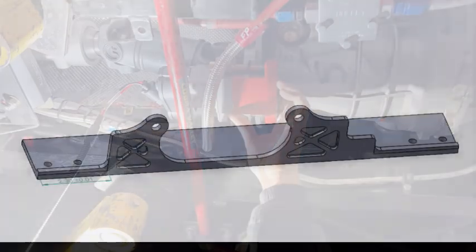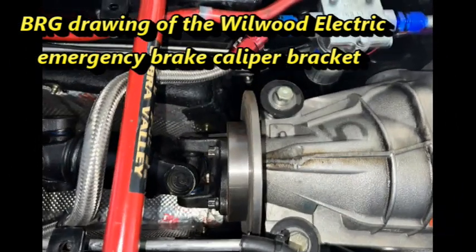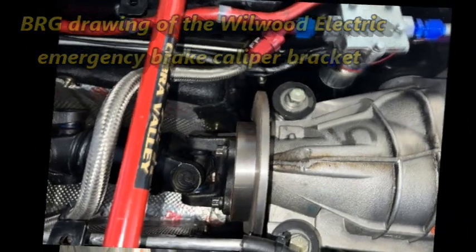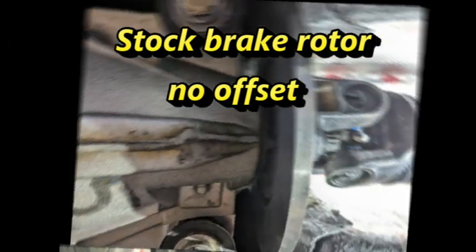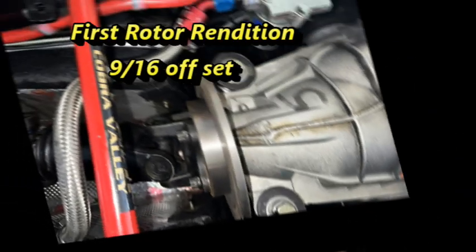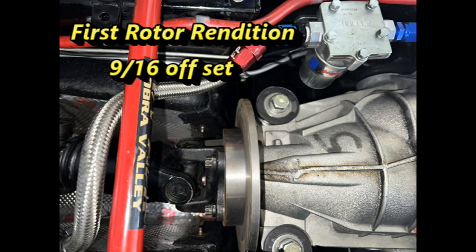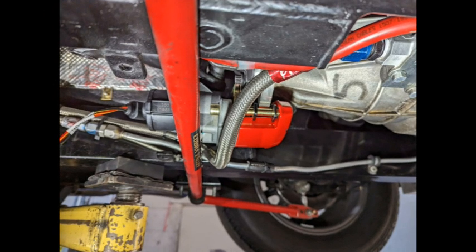This is the SOLIDWORKS drawing of the final BRG Wilwood Electric Emergency Brake Bracket that went on the car. You can see in the next picture the offset of the brake rotor. With the original brake rotor, there was no offset. We had to move the brake rotor position back toward the differential. On the final version, there's about 7/8 of an inch offset. It took two iterations to get it right. Using the offset to move the brake caliper further back toward the differential was the key for this kit working. It gave us the room necessary for the brake pads to have full contact on the rotor, and it gave us better clearance around the drive shaft. Clearance there was extremely close.